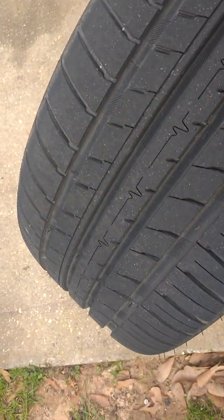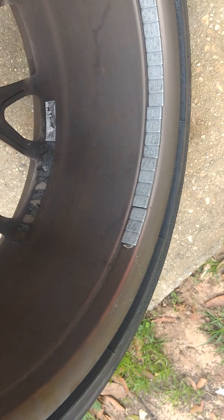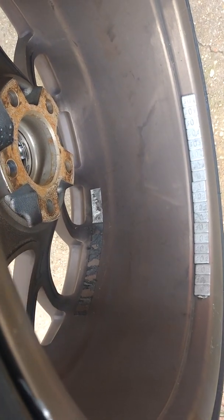I like the way they look a lot better than what was on there, but it looks like the guy put a ton of weights in this tire because my steering wheel vibrates at about 50 miles an hour. It looks like he was trying to figure out how to balance them. He said his machine was showing my wheel as a 21-inch wheel, but it's a 20-inch wheel, so I'm going to have to take this back to another reputable shop and have them put it on their balance machine to see if it's balanced right.